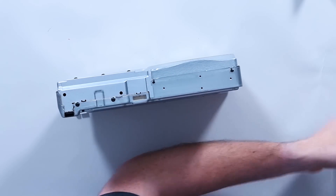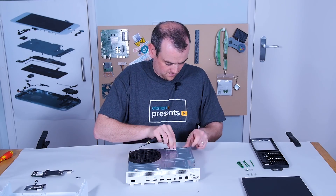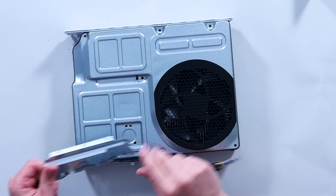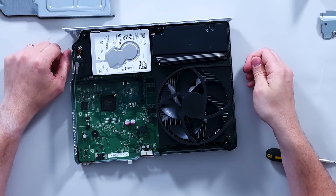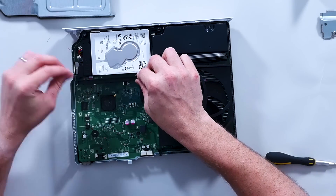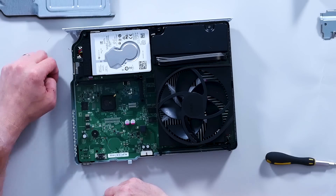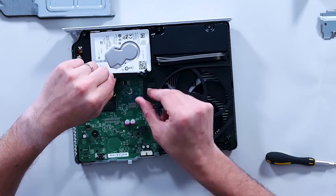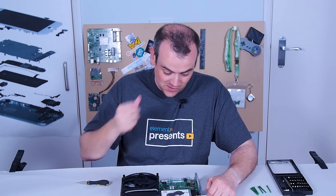On the side, you've got the RF chip for the wireless connectivity. I definitely feel like the eject button is our first clue for how this has been assembled — probably much more expensive to set up a new manufacturing process with a different board than it was just to keep the components on there, even though they're now completely superfluous. There's the front button. Getting into the RF shield means removing additional screws, which are completely new to this model. The edges and corners of the new pressing are much, much sharper than any of the original pressings, and it's actually slightly thinner gauge steel. Top of the RF shield is now free — and yep, just a big space. There's just a superfluous bit of plastic; you can clearly see where this held up the Blu-ray drive in the original, disked Xbox One S.